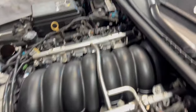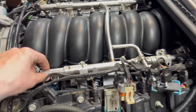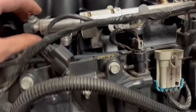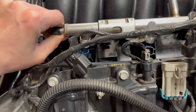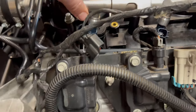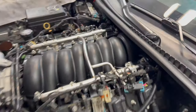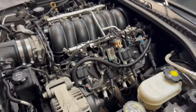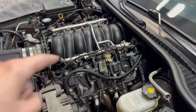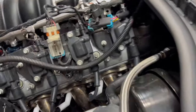We're on the home stretch. The only things left are to torque down the intake manifold and the fuel rails. Our injectors fit, which is good, but the O-rings that come on them are the black ones — they're supposed to be orange. With the LS2 intake manifold you need the larger orange O-rings that fit better into the little bosses.